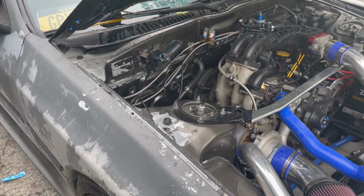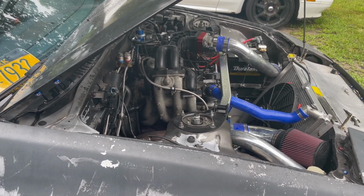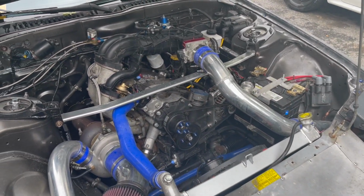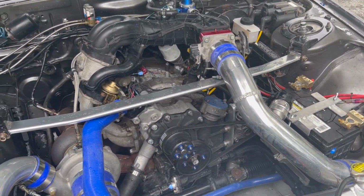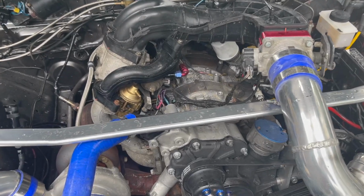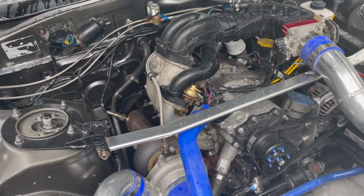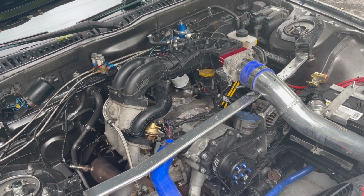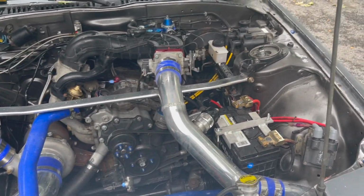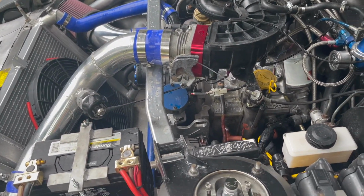We'll be switching the ECU over at some point here and retuning it, doing it on an old Microtech LT8 that was in the car with the ITBs. So, you know, it is what it is at this point. It was just to see if this would all work together with the FC front cover and all that stuff. In reality, if you're using a 4-port and you put stock injectors, mass airflow sensor on it, and TPS, somehow rigged up the TPS, you could probably run this all on a stock ECU, because you got the crank angle sensor and all that stuff.